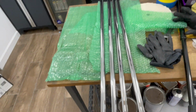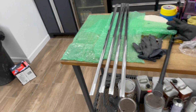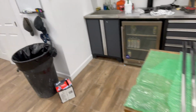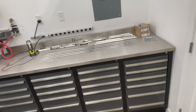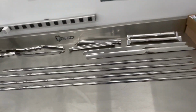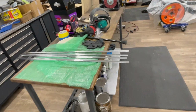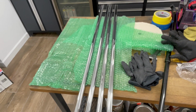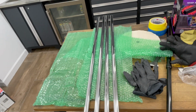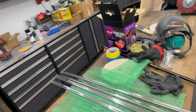Some little pits and a couple of dings here and there that I had to hammer and dolly out. Some surface scratches. So basically what I did was, after I got it straightened, I sanded it. I typically started with 400 and then went to 800, wet sanding it. Any surface scratches, everything came out. And I have never polished anything before, so this is all new.